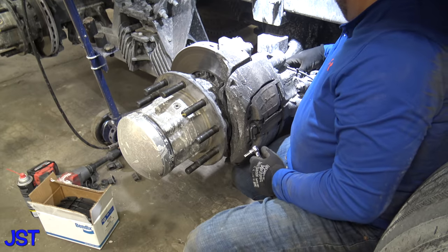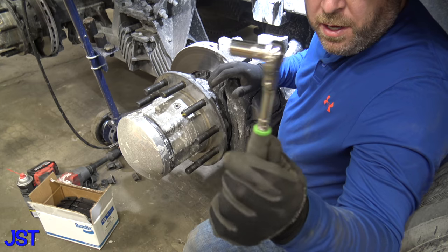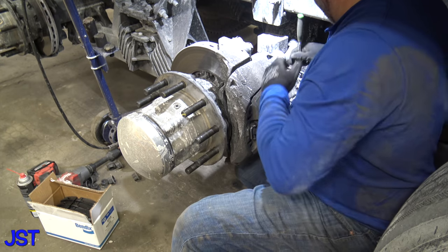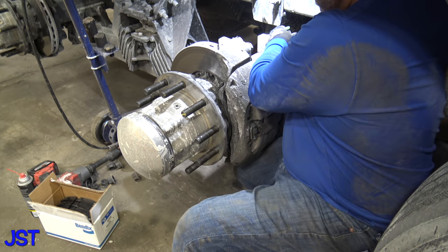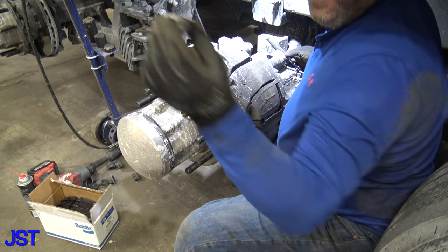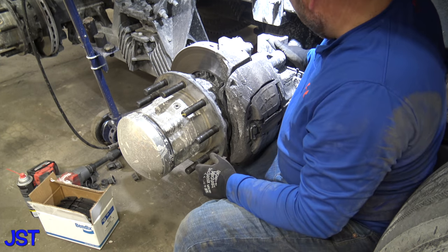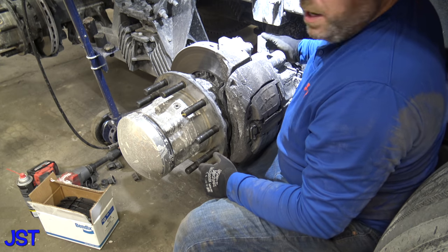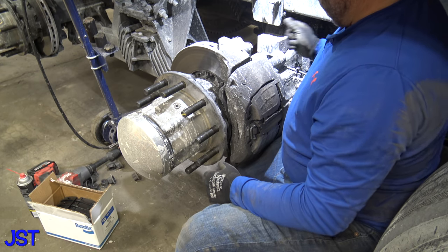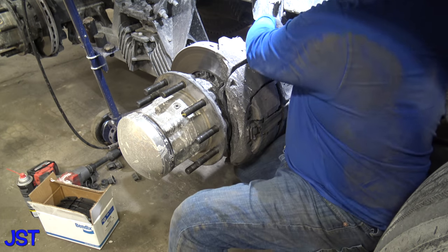Okay, so I'm in here. I'm just trying to stay out of your guys' way. Okay, what you need is a 10 millimeter ratchet. I recommend quarter inch, just so you're not putting that much torque down on this gear. And you pull off this little plug right here, okay? And this is how you roll the brakes back. So you wanna make sure you're going in the right way. You're gonna hear this click. So again, you just roll this back, and there's plenty of room to get these pads in there.